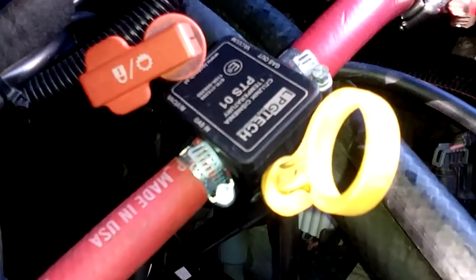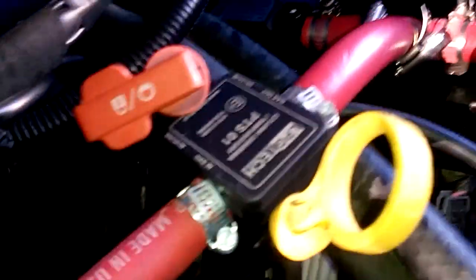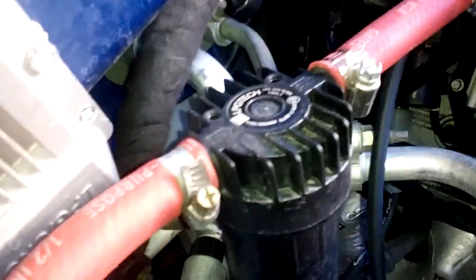I've got my hose clamps there — they're all hose clamped in. LPG hose, which is silicone 250 PSI hose, goes into my LPG tech universal sensor. It's got the pressure sensor and everything all built in, which is really nice. Then it goes into my LPG tech filter, which is just a fantastic filter.